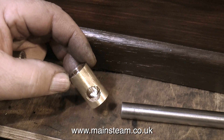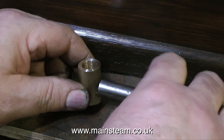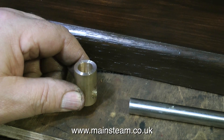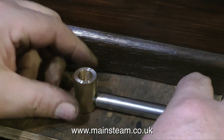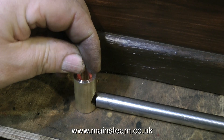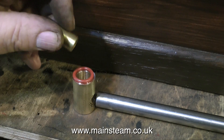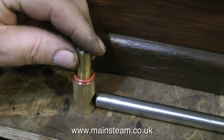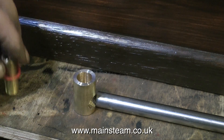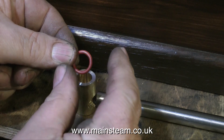If I use a piece of tube like you see on the right-hand side for the horizontal pipe and some kind of adapter for the vertical pipe, making it so that the horizontal pipe screws into the vertical adapter which can then be fitted with an o-ring to take the pipe from the cylinder — this may turn out to be a little too complicated. I think a simple plain turning which screws into the cylinder and has a screw thread on the side to take the horizontal threaded pipe should be sufficient. When it's all finished off with a nice external flange it should look pretty good.